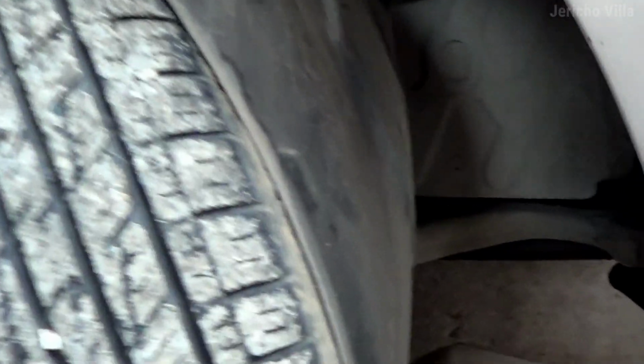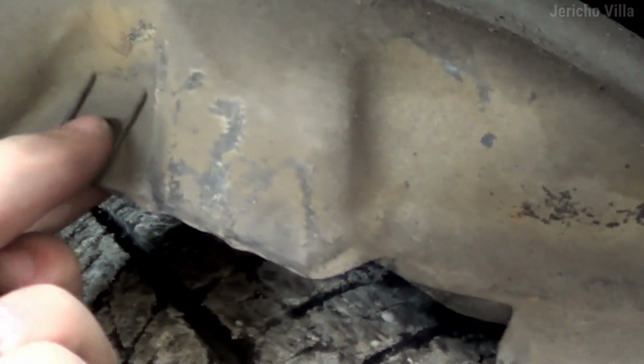On the other side, the location of the screws for the fender liner is the same, but you have your wiper wash tank getting in the way. So you're gonna have to go under to reach the bulb. I don't know if the camera can see it, but it's in there. You just have to be flexible with your hands.